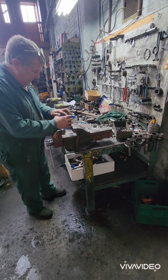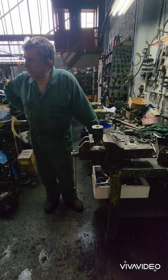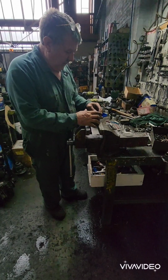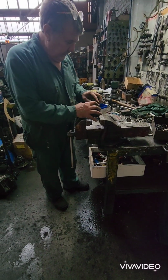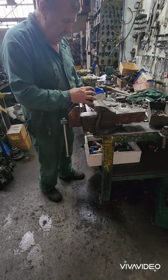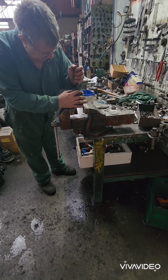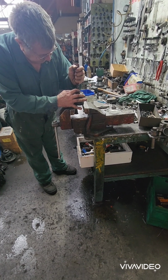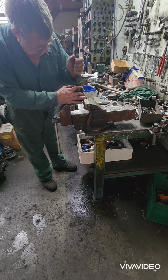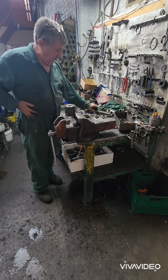This part here, the side gear, is lower than that. Sometimes in those carriers, in Nissan Patrols, they have a thrust washer that goes on here. But these don't have a thrust washer because they never get past the clutch hub, because there's proof of it, you see. You put a steel rule there, and it's well lower. A little bit of slack there doesn't go past it either. You feel it, that it's sticking up, see? This is higher. So anyway, that's how you got to do these bloody things.